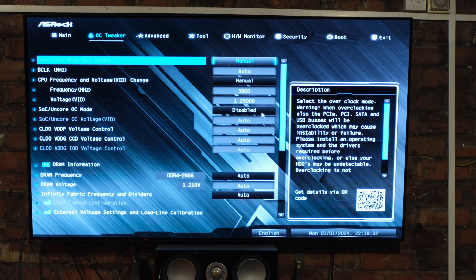I think that's about as far as I can get in the BIOS. What I'm really keen to do now is install AMD Ryzen Master on Windows and see if I can improve things further, because that tool lets me change settings through a GUI in real time. Let's dive into Windows 11 and see if we can push the wattage down even further.